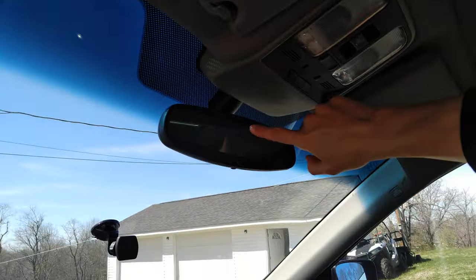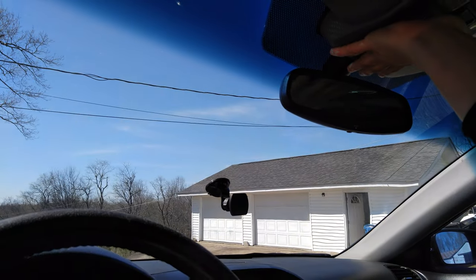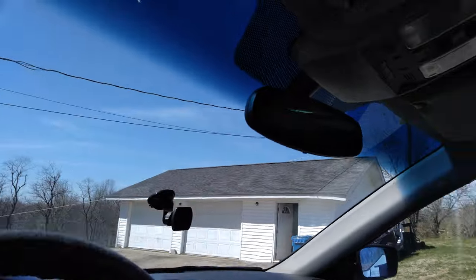If your hands-free link doesn't work in your car, chances are this is what's making your battery go dead. The hands-free link module is located right up under here. If you feel it after you haven't driven the car for a while and it's warm, it's still thinking it's doing something — trying to connect, whatever the case is — but that's what the problem is.